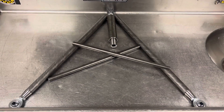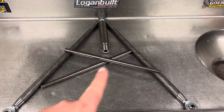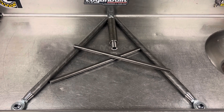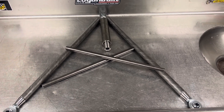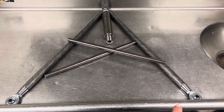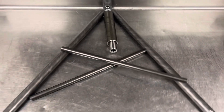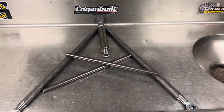If you've never seen a wishbone before, they look a little something like this. Essentially, what this allows your chassis to do is go through the full range of motion without moving the axle left to right. This is because you have two mounting points on the chassis side and one mounting point on the axle housing itself, so it freely moves up and down with the suspension.